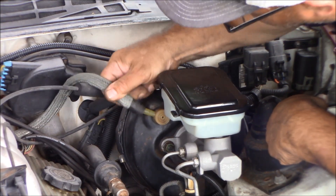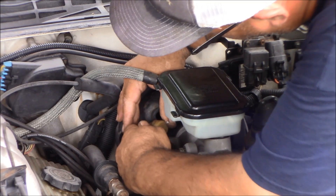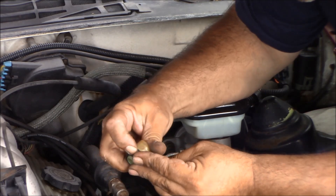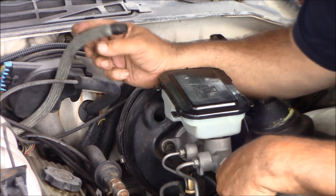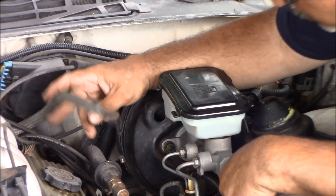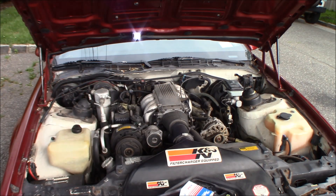This hose is really sloppy — I don't think it's actually brake booster hose. When we pull the check valve out, we did get a little vacuum, so the check valve was working. This hose is hard, and where does it go? It's sort of looped over the throttle cable, which it probably shouldn't be — it should probably go down here, straight across. The other end of the brake booster hose is just below this piece here.